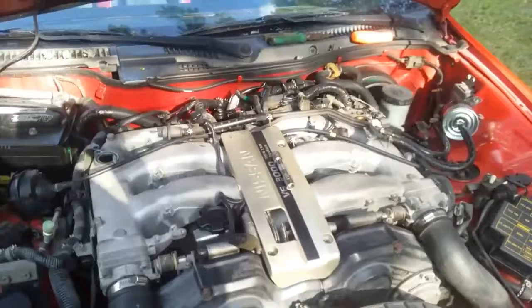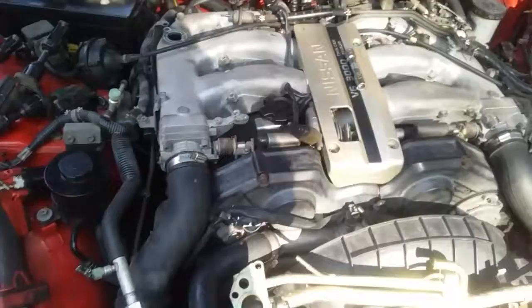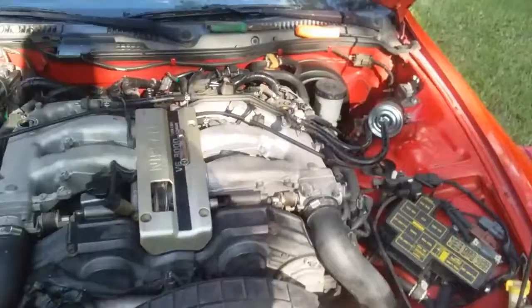What we're gonna have to do in the near future — not today, just patchwork today — is coil packs, possible cleaning of fuel injectors, a plenum pull so we can get the valve covers off and change those gaskets. The gasket kit comes with all the O-rings for the spark plugs, which should stop some of that leaking. I guarantee this is probably where some of my smoking is coming from.